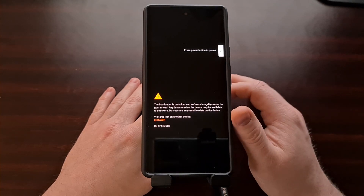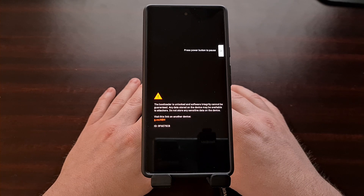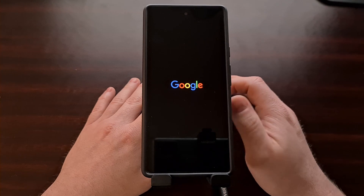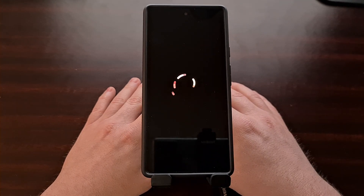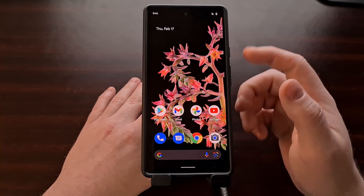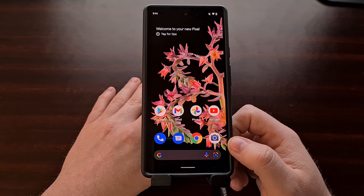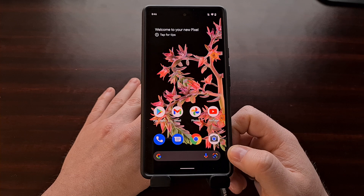When we see our smartphone or tablet reboot, it's going to go through the typical boot animation sequence. We're going to see the boot splash screen and boot animation before booting into the actual Android operating system itself. So even though we did not use the power button, we were able to boot out of recovery mode and back into Android by using the `adb reboot` command.